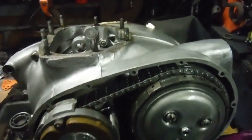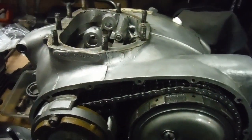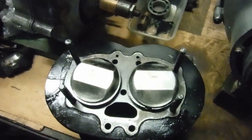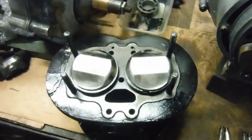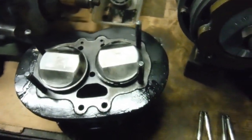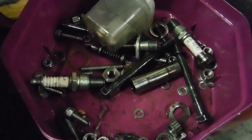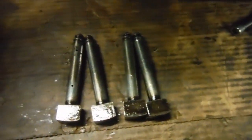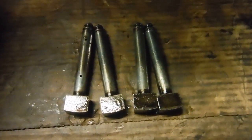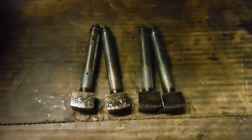It's a Monday morning and here we are back with the Jigsaw BSA A65 engine. I'm at a stage where I'm considering fitting the pistons and getting ready to fit the cylinder barrels, assuming the pistons, rings, and everything gap and fit as they should in the bores. I've also run into some dilemmas — there are four cam followers that were just scattered around in the Quality Street box, and the odds are very low of getting them all in the same order and positions as they were last time the engine was together, so I'll just have to fit those and hope for the best.